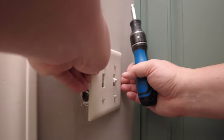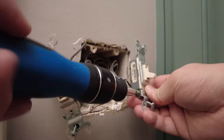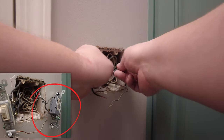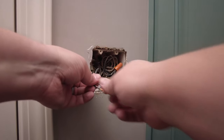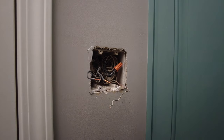Don't forget to put back the insulation you removed, especially if you have attic access. Now we're not quite done yet. Since this unit uses a wireless remote instead of a typical switch, we're going to have to go install the receiver at the wall. Always check to make sure the power is off before grabbing the switches and pulling them out. What I've done is taken the wires that were to this light switch, twisted them together, and put a wire nut on it so the fan has constant power — I thought I recorded that part but my camera was off. The other switch powers the light above the vanity, so instead of keeping a normal switch next to this new wireless switch for the fan, I'm going to install a paddle switch next to it so it looks nice and matches.